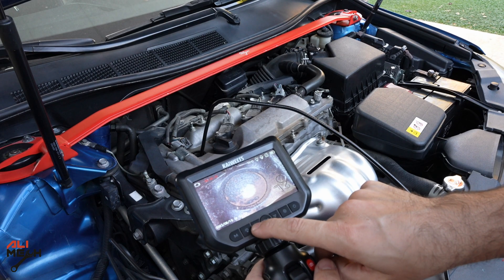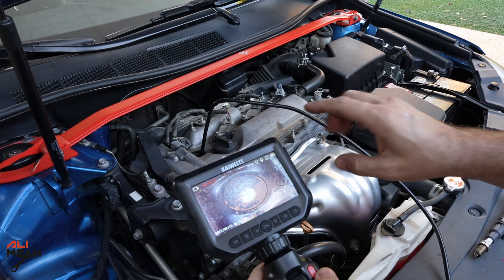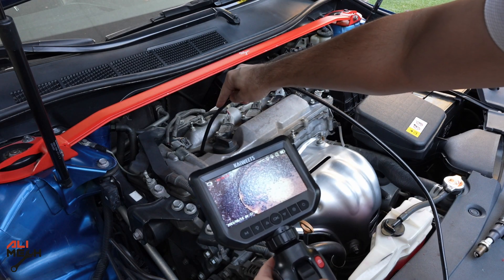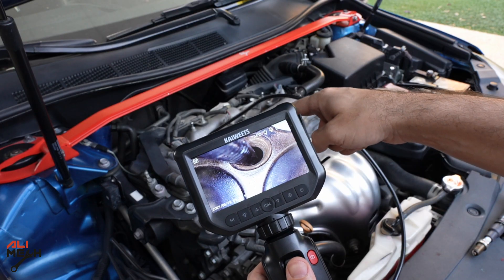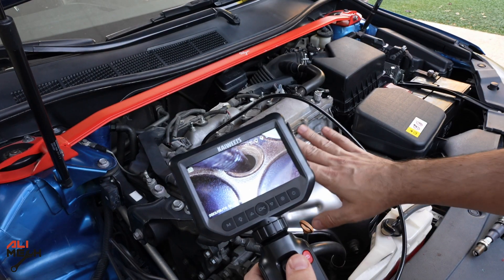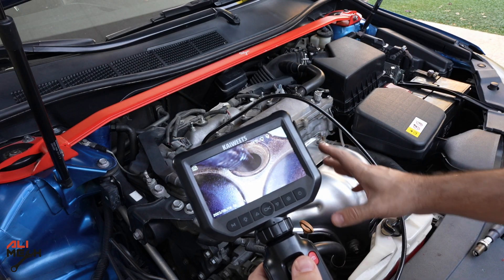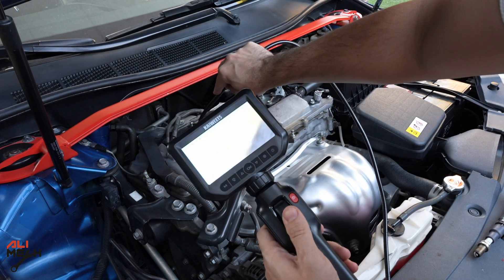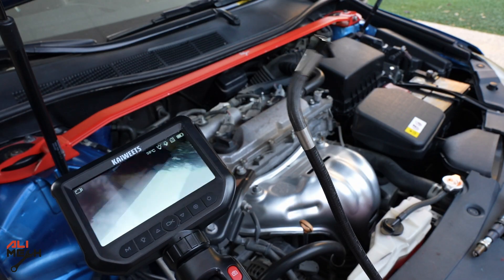You can still zoom: here's one zoom, here's two, here's three, and that's the normal view. We usually need a wide angle so we can see everything. Now I'll push it a bit more so I can look at the intake valves. I can already see the spark plug hole that the endoscope camera came through. It's also showing the temperature — it's rising, 54 degrees. The engine isn't that hot; I just turned it on, which is why there's some heat. We can already see the valves very clearly. Now I'm going to straighten up and get the camera out — that's the advantage of this endoscope camera.